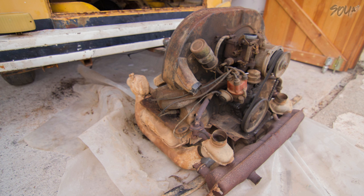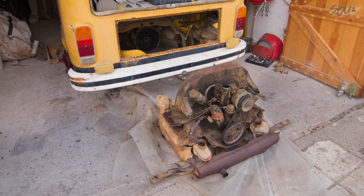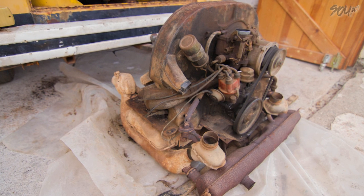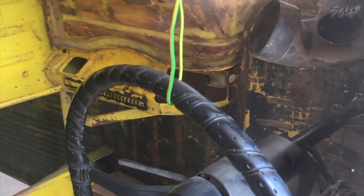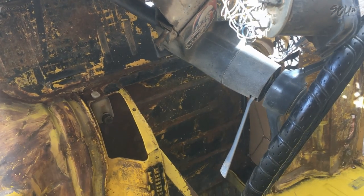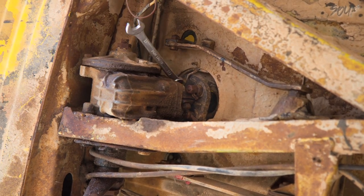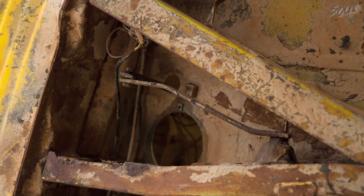This is really going to be just a quick video to show you how simple these things are. This engine comes out when you take out only six or maybe eight bolts — a couple at the aft section on this bar and four on the back that attach it to the gearbox, and that is it. It's such a quirky little engine; I'm sure if you just fed it some fuel and a 12-volt feed it would sit on the deck happily running. If you ever hankered after one of these and wanted to do a restoration, this is a great thing to get. Because of the size of this thing, everything's kind of spread out and easy to get to, plus there are some really simple engineering concepts at play here that aren't on your average car.